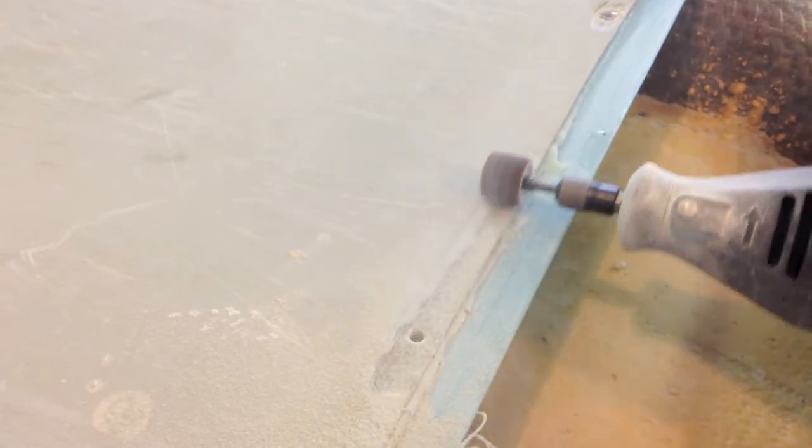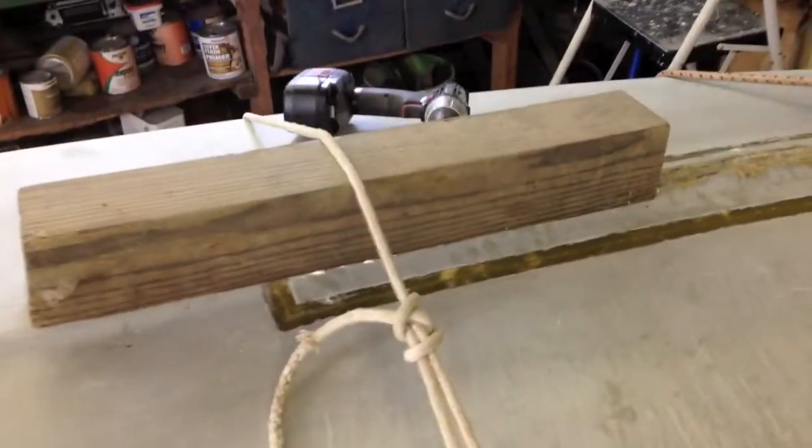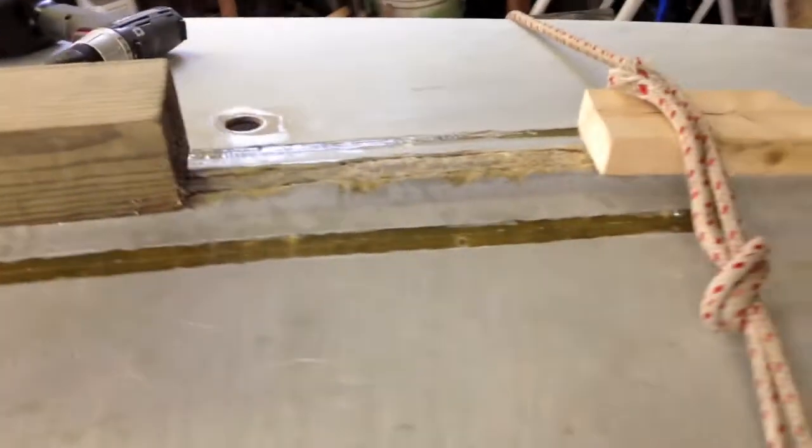Its strength is probably about 75% now and it fits nicely. Just have to clean it up with the Dremel tool. Now I'm going around cleaning up, taking away about half an inch of the gel coat around the edge so I can lay some glass down.